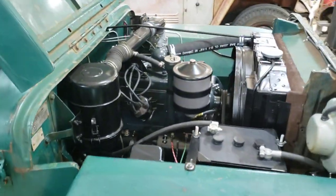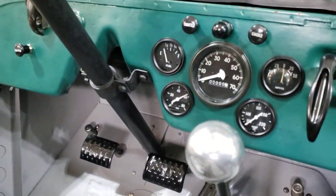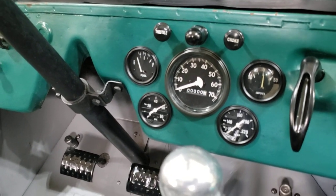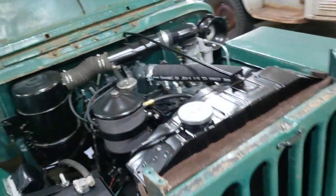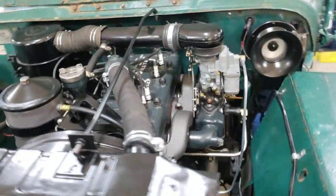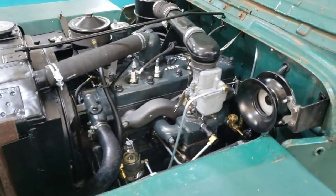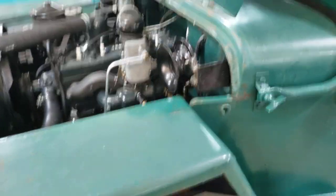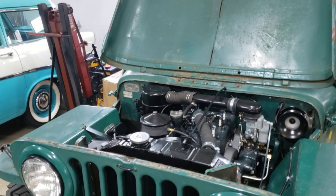I think I'm pretty happy — that rascal just went right up, like they're just parking. Too cool. Coming around looking at some instruments — yeah, we got a little bit of gas, and that's true. We got about 55 pounds of oil pressure indicated. Charging ever so slightly. No temperature yet, of course. Running a little bit fast — after I shut this thing off we'll slow down that idle and mess with the distributor, get timing and idle screw set up. By golly, she runs really well, just instantaneous. Here's the new exhaust manifold too. Nothing's leaking. So I'm going to call that a win. Vintage Don, out. Thank you.